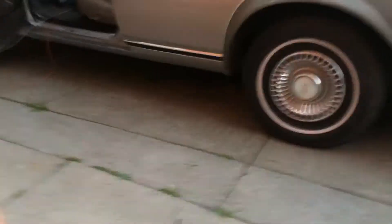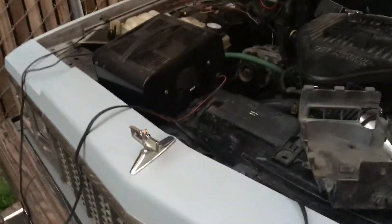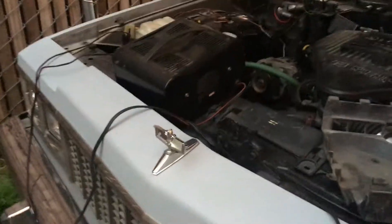I'm going to turn this car on to the on position. I also have my battery charger on here — you want to do this because they say if anything happens while you're saving or loading the program it could break the computer, which pretty much means you can't use it anymore. So you want to keep the voltage good. Don't trip over the wires — that's what I'm telling myself.